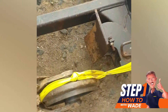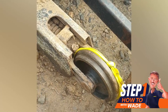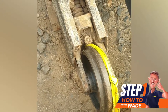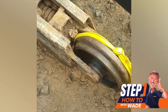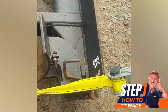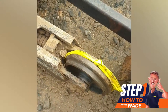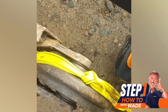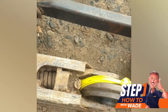So changing tracks and pulling the idler wheel out for maintenance and cleaning — obviously they get jam-packed full of dirt. If they were new they'd slide in and out by hand, but mine wouldn't. So what I did was reverse the vehicle up, put the ratchet strap on and put a lot of pressure on it, then gently tap each side of the wheel back and forwards. You can see I made some marks there — it was moving out about a millimeter at a time.